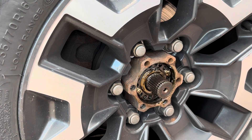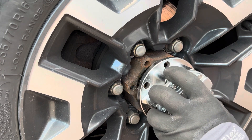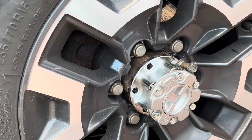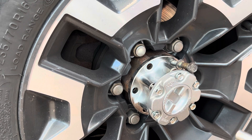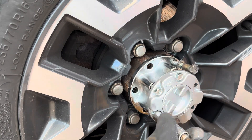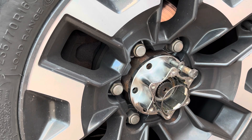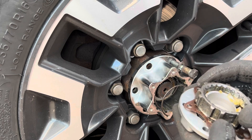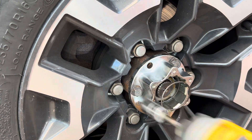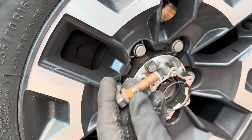Here's our selectable hub. I'm going to have to put the C-ring on, hold it and get it to hold the end of the stub shaft here. I can go ahead and bolt that up. These bolts are 10mm. This would have been a great time to put some anti-seize on those, but I did not.